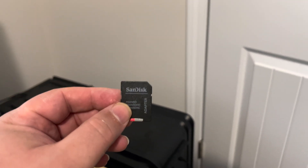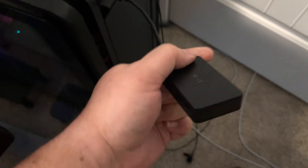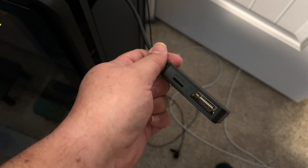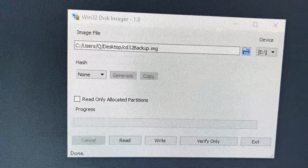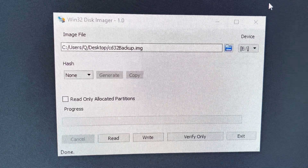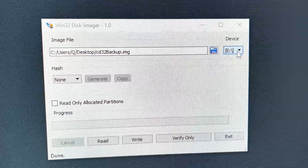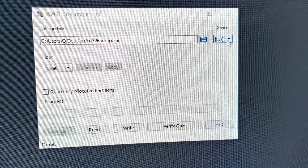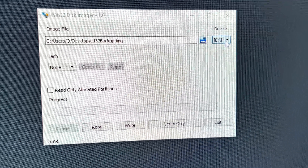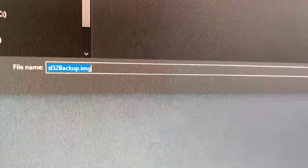Here we are over on my PC. I'm going to take this SD card and plug it into this multi-IO card reader. You'll need some kind of multi-IO interface card that lets you plug in all of this. I'm going to put it in here to get it into my Windows PC. Then we're going to use a program called Win32 Disk Imager. You can Google this and find it — I'll put a link in the description. It's very simple. Once you insert that card, you have to figure out what drive letter it is. In my case, it's E. Keep in mind, when you plug this card into your PC, it may pop up a requester saying it doesn't know what this is and asking to format it. Make sure you say no — hit cancel. Then you're going to pick the drive that the card is, which in my case is E.